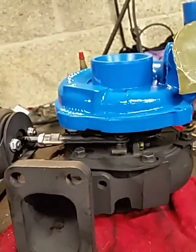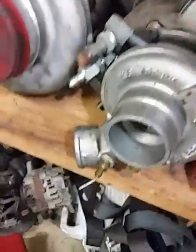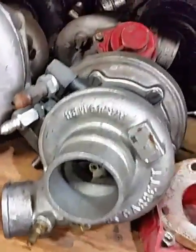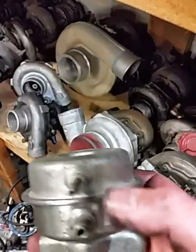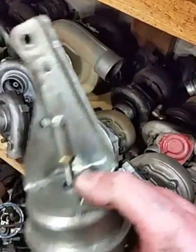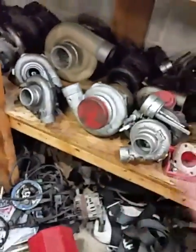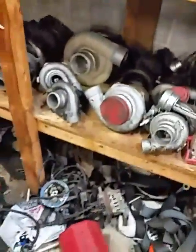There's a concentric in here that turns. So how do we control it without fancy electronics? Garrett years ago used this little gem right here — this is a VNT 25, used on some very special Fords. It has a little wastegate right here. I looked at it and thought: you've got boost on one side and vacuum on the other. The thing is they used a silicone seal right here which prevented the boost pressure from leaking out. You couldn't find those again if you wanted to. This one unfortunately had an oil leak in it, and no rebuilder would touch it because it's a variable — something to do with their contract.